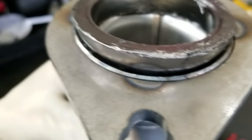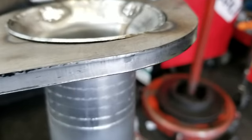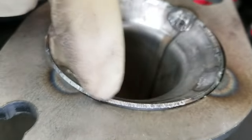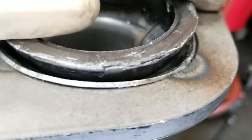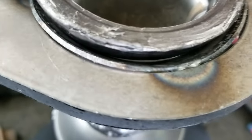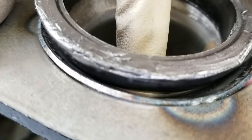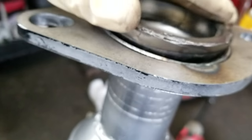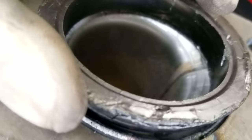I want to describe the shape since it's not exactly going to show up on the camera. The flange has four flat spots — it's round, flat, round, flat, round, flat. The gasket will not seal. If I clamp it down all the way, you can see where the weld spots are right on the sealing surface — that's definitely not going to seal no matter how hard you clamp it down. This piece is also designed to swivel, so it's just going to be a big mess. Just don't waste your money on this kit.